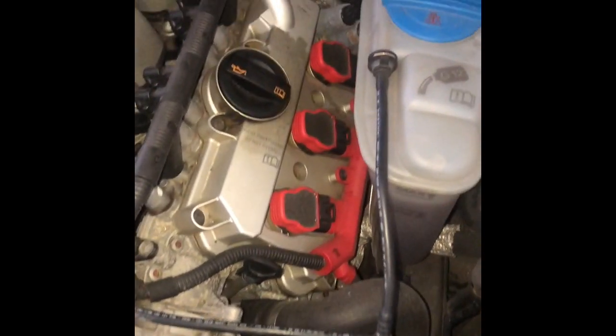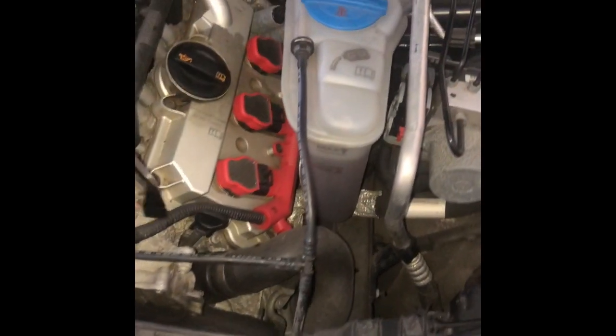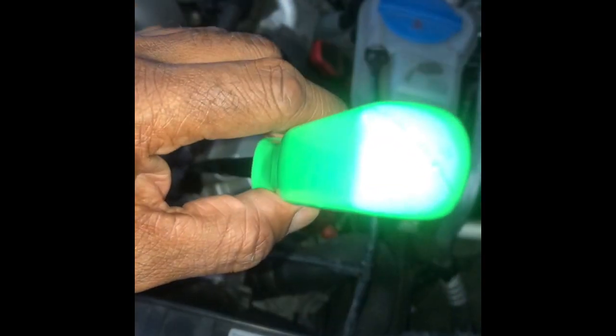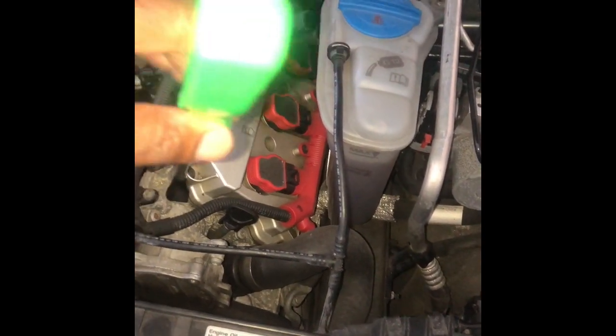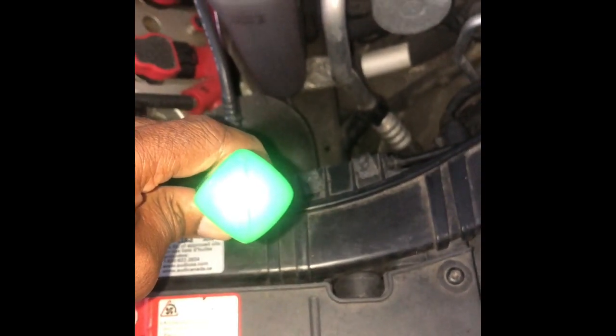So what I did was I took like a screwdriver, something, this is a pry bar. But when you got noises from the engine, you're hearing from all over the place. You think they're coming from the back, from the power steering pump down here. I was just checking everywhere, so I would take this crowbar, or should I say pry bar, or what I used was a Phillips head screwdriver. It don't matter, flat head, Phillips head is all the same. But I would stick it somewhere, like for instance, if I needed something long, I would stick it down on here, and I would put my ear to the top of this pry bar right here. I would just lay my ear on it, and this is how I would find what is whining.